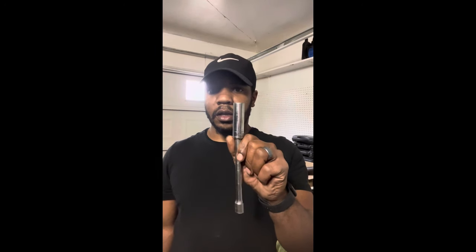All right, guys. So now I got all the sockets that you're gonna need. You're gonna need 18, 15. These are for the front bolts that go to the transmission. And then you need a 10 to go to the diff. And then this is for the carrier. Those are 13s. So I'm gonna get the camera set up down there so we can get the stock drive shaft off.